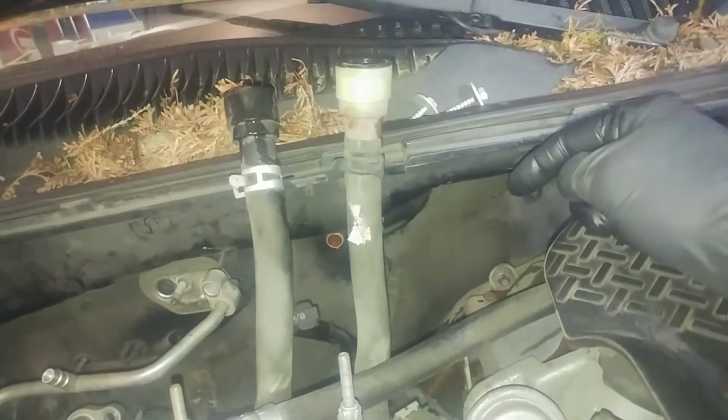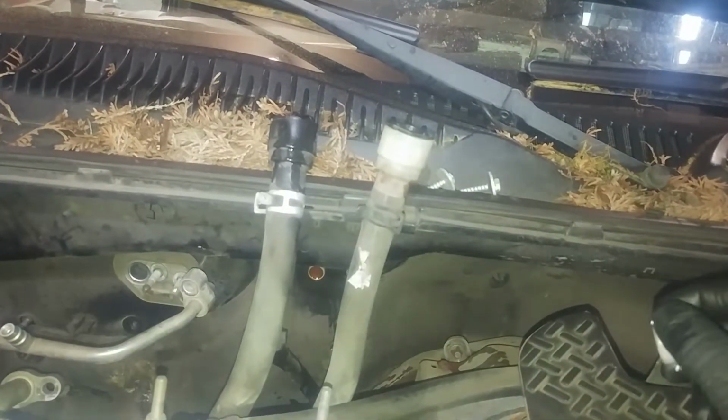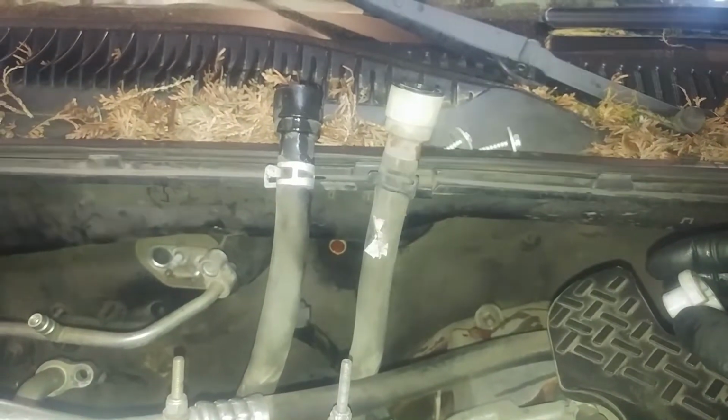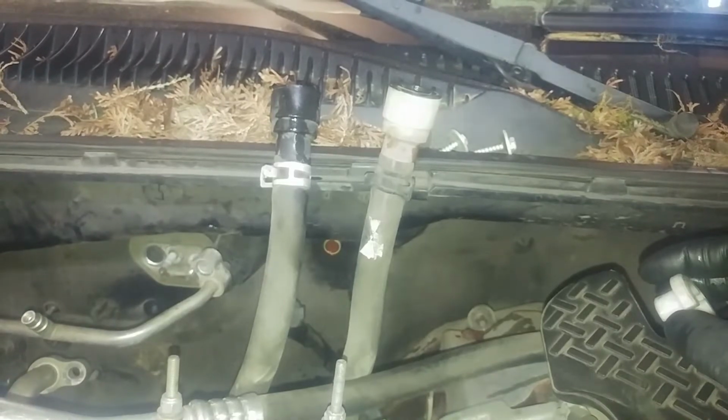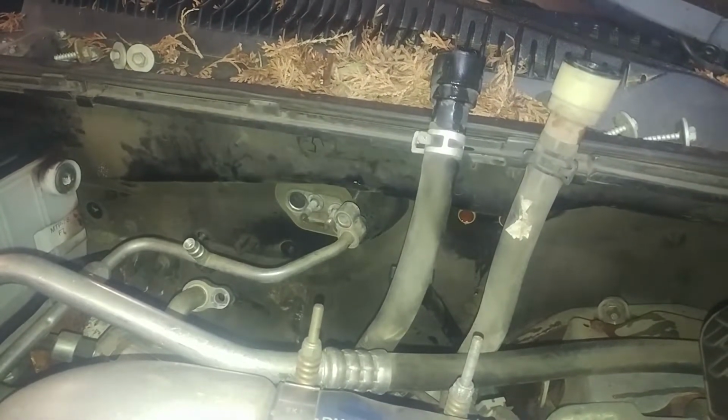But I will say it can be kind of a fight, so probably it is best to cut the pipes, and you have your stubby pipe section, and then do it right out here in the open, nice and easy for you. But I thought I'd give it a shot doing it the more right way, and it worked out. So I got all my, I think 4 screws, 3 nuts out here. So I think we're ready to pull the dash back. Let's go ahead and take the lower cover off here too. Nice beauty cover trim. 7mm bolt, I believe. Right here. And one more, a little tricky, right in here.